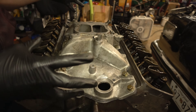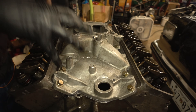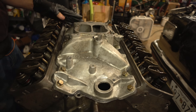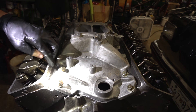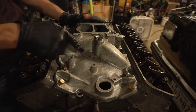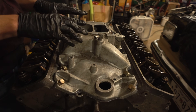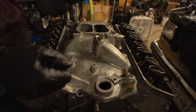I couldn't really stop to deal with the camera since intake manifolds are kind of stressful - it's a time-sensitive process with RTV everywhere. You really have to have thread sealer, and intake manifolds can get kind of choosy about lining up just right. I checked the front and back seals to make sure it looks sealed up tight, and wiped off any excess RTV that squeezed out from the coolant ports. All the intake manifold bolts are torqued to 30 foot-pounds - you want to do that in several passes. I'll come back in about 12 hours and retorque everything. Ideally you'd do it after heating the engine up the first couple times, but that's not really possible here, so we'll torque it down to probably 32 foot-pounds and leave it.